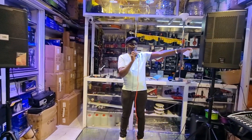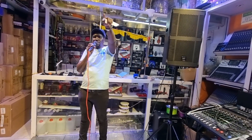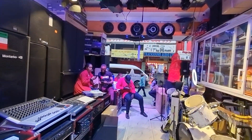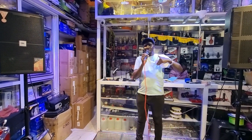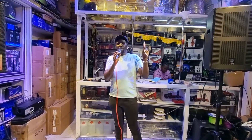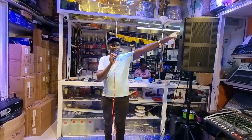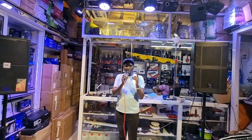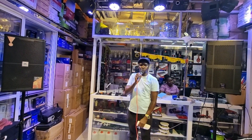This is good positioning for people who have small stages, small churches, or small platforms. Always make sure your main speakers are in front of you. When I speak, the sound goes into the speaker and feeds the audience going outward — there's no way it's going to come back. Stand behind your speakers, but the best position is to place them as far away as possible, at the farthest corners.